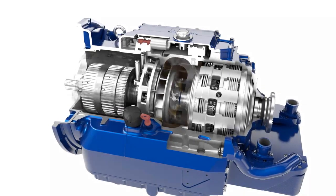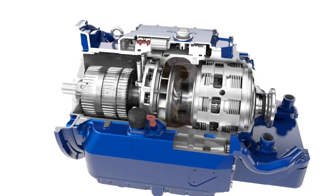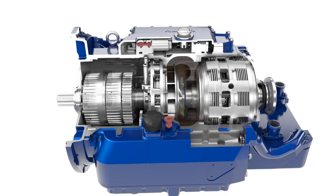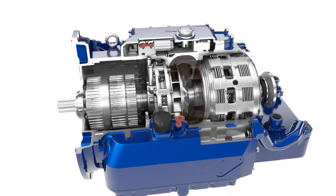The planetary gear shaft transmits both the torque of the input differential — that is, the purely mechanical share — and the torque of the turbine gear — that is, the hydrodynamic share — directly to the transmission output.